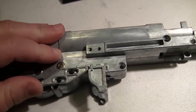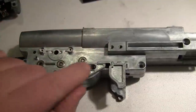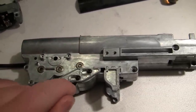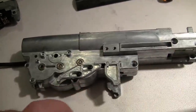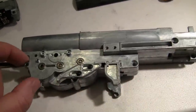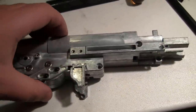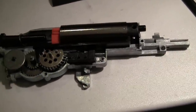So, if you look here, I pretty much got this fixed. To get into the gearbox you have to take this off — I put it back on because there's a screw hidden right here. It's one, two, three screws for the gearbox and two for the motor, plus the plate on the top. Let's take this apart and take a look at the inside.